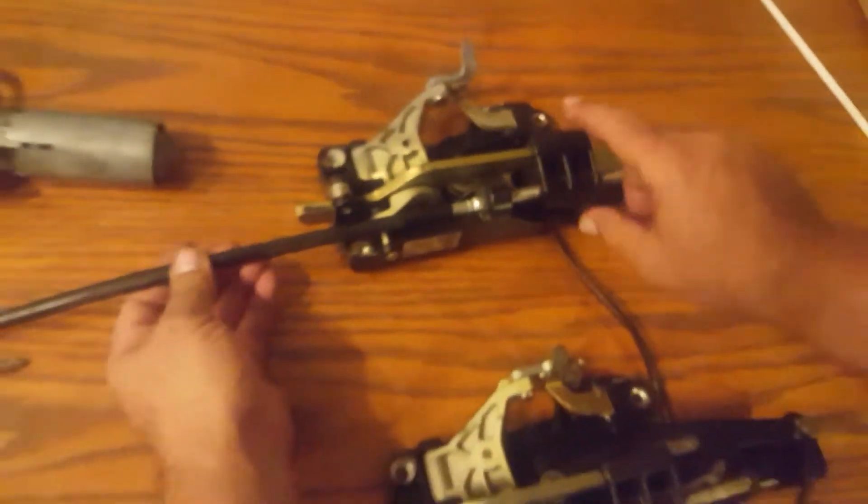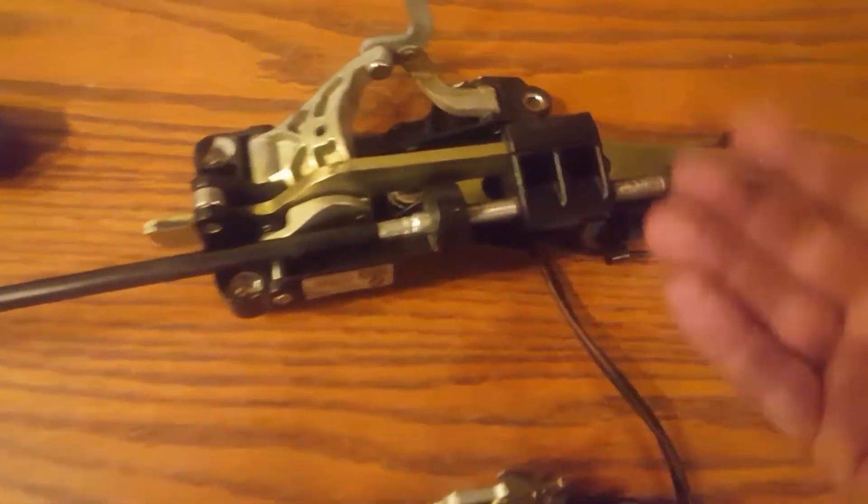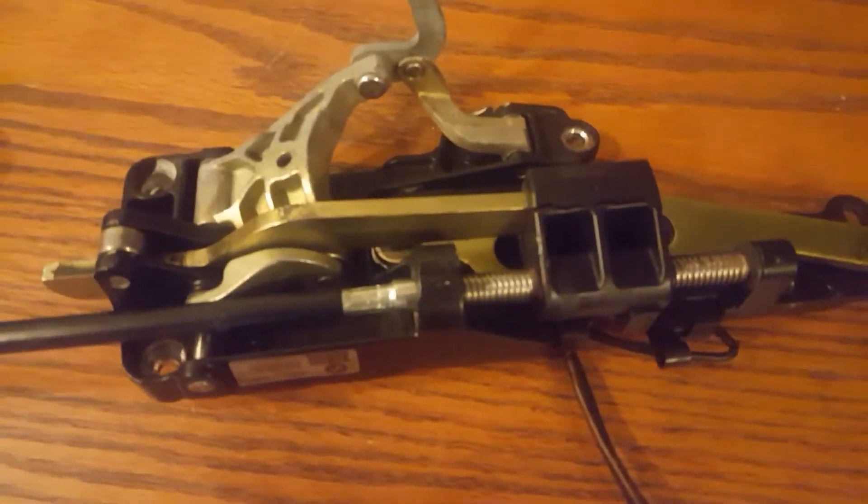The reason why the motor broke and the gear stripped is because the latch is broken, so it bound up and caused the gears to strip out and crack.